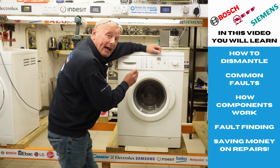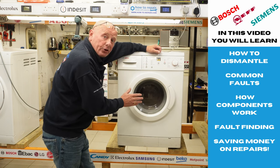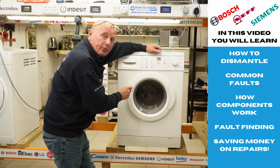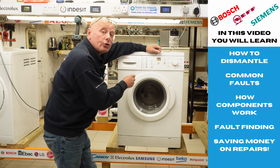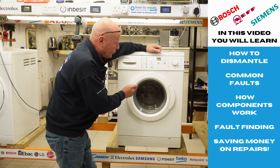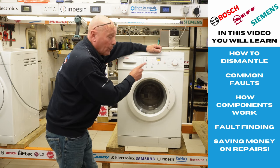This is because the aluminium spider has now broken and the inner drum is hitting the outer drum. So in this tutorial I'll be going through how to dismantle the machine and how to change the drum. I've done a previous video on how to replace the bearings on these machines and how to replace the carbon brushes, the pump, and all other faults. We're just coming up to about five or six hundred RPM and the noise is starting — you can just hear it, a little bit of suspension noise — and now we're getting the drum noise, which gets louder and louder as it goes up to 1200 rpm.